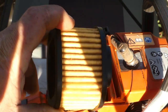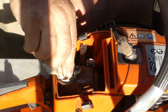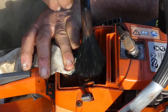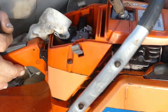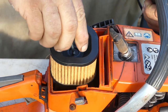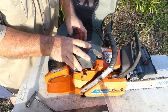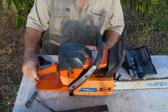I've blown the filter out and it's nice and clean now. Before I put the filter back on, I just want to put a little bit of rag very carefully in the carburettor entrance to keep any dust out. I always keep a brush in the ute with my chainsaws and I just use it to generally remove dust. That's got rid of everything there — none got in the carburettor. Now I'll put the filter back on, do the screw back up tight, make sure there's no dust inside, put your lid back on and do your retaining clips up. That's all there is to cleaning the air cleaner. I'm now going to sharpen the saw and grease the bar.